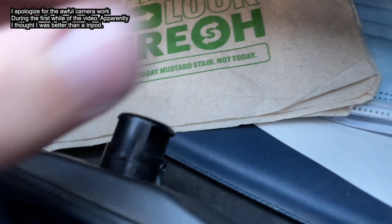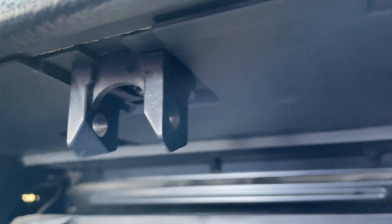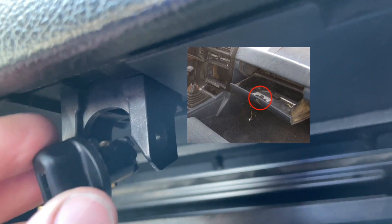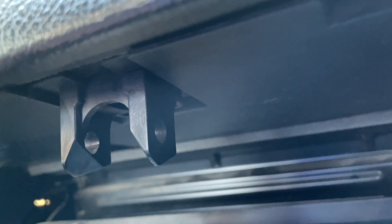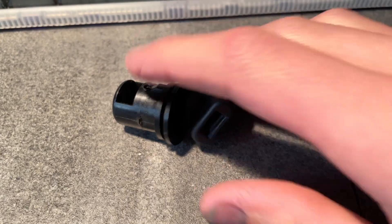Here's the problem with my glove box and why it won't stay shut. It's got this piece and there's just a hole. The little handle thing — the end busted off, and from looking at some pictures online, it looks like there needs to be these little spring-loaded things on here that, when you turn it, will release. I've just been holding this shut for the past two years with those springs.